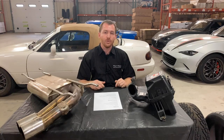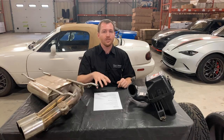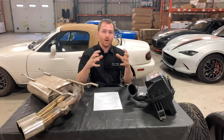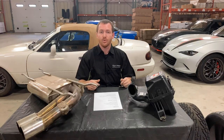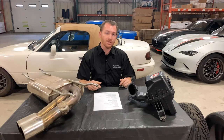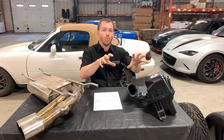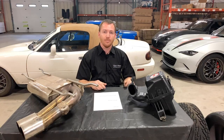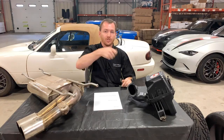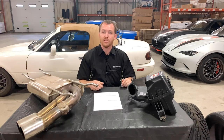You can take your car and go through car washes that have undercarriage washes, and that'll help — especially if you live somewhere that uses a lot of magnesium or salt to melt snow or ice on the road. It works great for traction, but it also works great for rusting your car, so preventing that from staying on your car for a long period of time will help. Going through and washing the undercarriage is especially important. If you park in a heated garage, believe it or not, that can actually make it worse because as the car cycles from cold — with that gunk on the undercarriage — to warm overnight, that actually promotes rust propagating even quicker. So keep the undercarriage and suspension clean, and if you can get in there with a pressure washer and clean your wheel wells, that'll go a long way toward keeping the car as rust-free as possible.